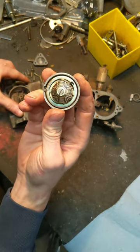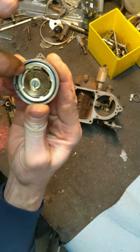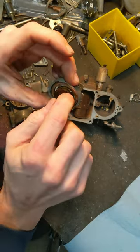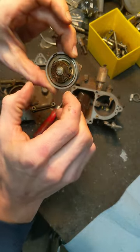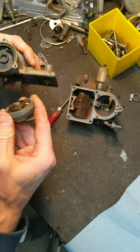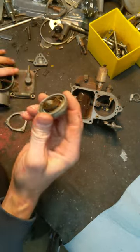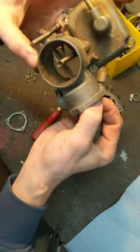In here you kind of end up with a thermostat spring, which is kind of like what this is. And then there is a heater element that's wrapped in some ceramic in this particular one, right in there. So when you turn the ignition on in your car, it sends 12 volts to this, and this will start to heat that up, which will heat the coil. So it would be pulling that way — it would hook on this side of the spring, this little nib here. This nib controls its attachment.